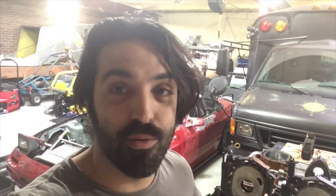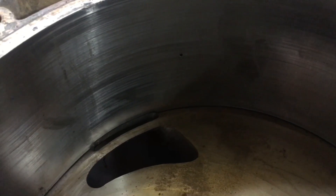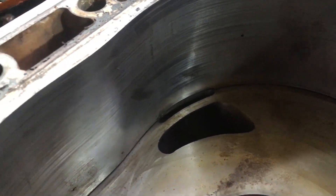To sum it all up: that rumor that you can't use a two-piece apex seal on a full bridge port — that's demystified, at least with the examples I've given right here. What I've found is that you can't use a two-piece apex seal on a full bridge with the eyebrow cut or scallop on the housing. Thanks for checking us out here on Playback, catch you next time.